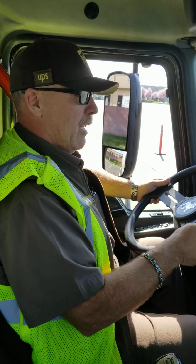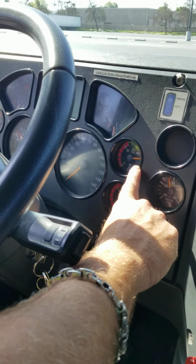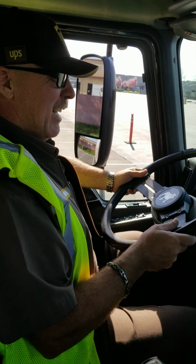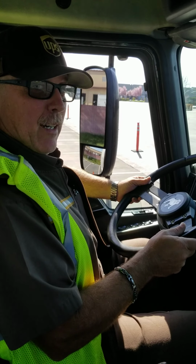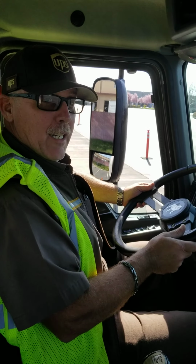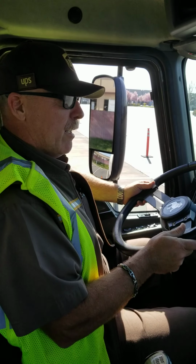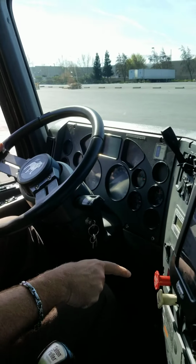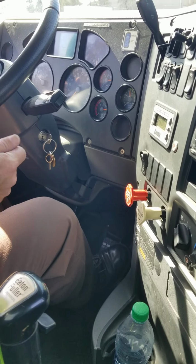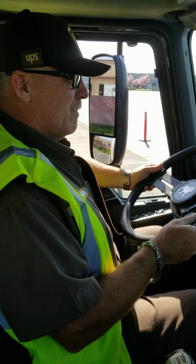With my engine running and 120 pounds of air pressure, I'm going to fan my service brake, reducing my air pressure. When in between, I'll stop regularly to allow the needle to stabilize and call out whether the needle is stable or rising. With the parking brake applied, trailer protection valve applied, transmission in neutral, I'm going to begin fanning my service brake.